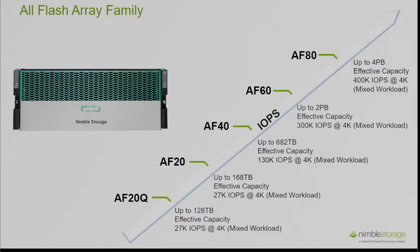Let's now look at the all flash array. As you can see, the performance levels in these arrays are similar in IOPS to the hybrid systems. So why would you purchase the all flash array? Well, the all flash array would guarantee low latency reads as all reads would be served by SSD, whereas on a hybrid there is only a subset of SSD used for read cache. Therefore when you have a cache miss, reads would come from the hard disks where latency is naturally higher due to mechanical components.